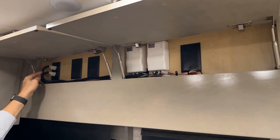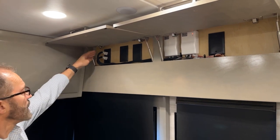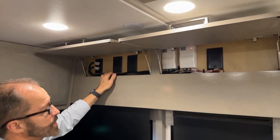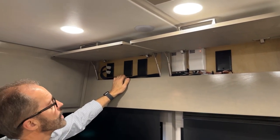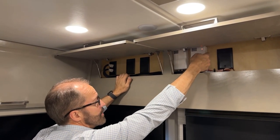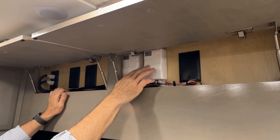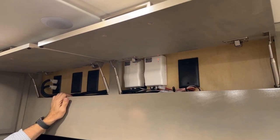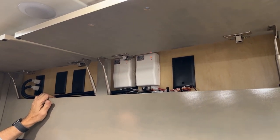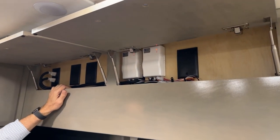Below that are your door awnings, entrance door awning, and entrance door awning light controls, privacy drapes, and security lights. This area also provides RVC network access for diagnostics. In the compartment there are two plugs for the Girard awnings — if the generator is running or the inverter is on, you'll see red LEDs lit up. The awnings are on a GFCI circuit — if the GFCI breaker trips, the awnings won't work. You can also operate awnings with the in, out, and stop buttons right here.